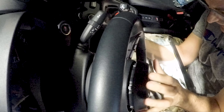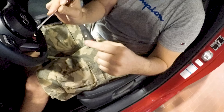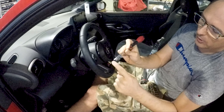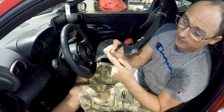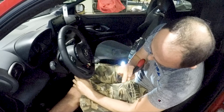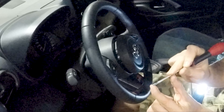You push it a little bit and now all three springs are unclamped and the airbag is out. Please have a look at this detail: this is the distance that the screwdriver has to go inside — about two inches or five centimeters.